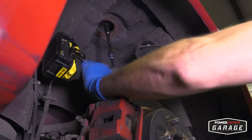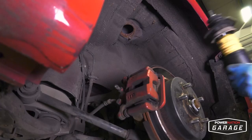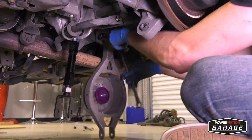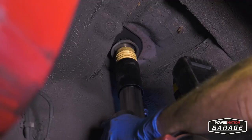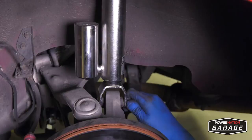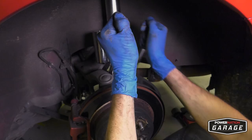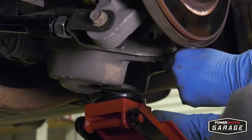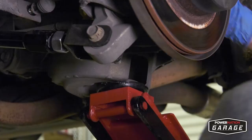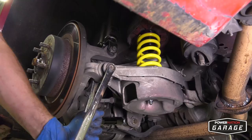Reinstall the lower control arm starting with the side closest to the center of the car. Reinstall the new shock the same way that you removed the OEM shock and be sure to not go too fast and make sure those bolts are nice and snug. Install your new coil springs with the crush spring and put it into place in the lower control arm spring bucket. Using a jack, join the control arm with the spindle bracket and tighten the bolt once it's in place. Finish it all up by reinstalling your strut bar up front.